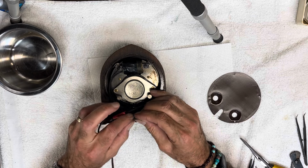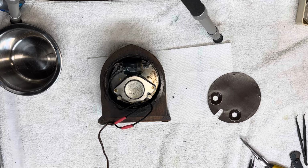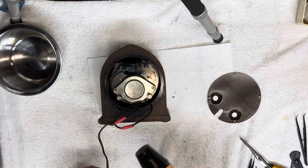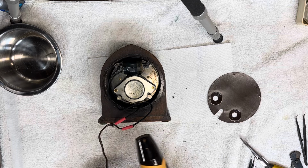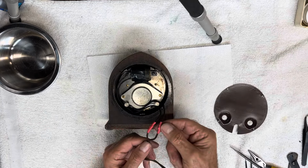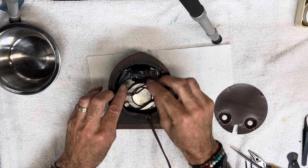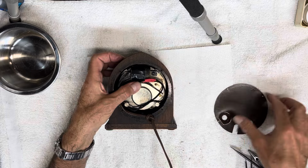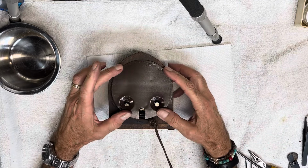Okay, so once I hit it with the hot air gun, which is this, those will shrink up, be nice and snug. This makes a lot of noise, it'll take a minute or two, so let me do that on my own. The tubing is shrunk, the connections are nice and secure. Now I'm going to position the wire into the case and then place the back plate on, and I'll do that on my own.